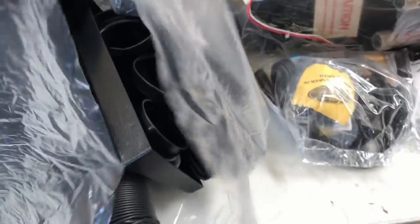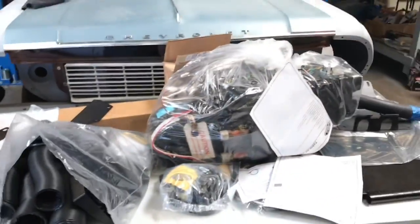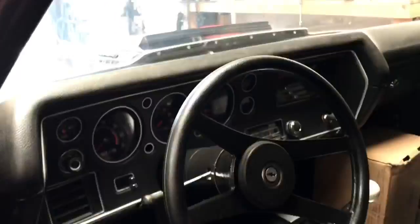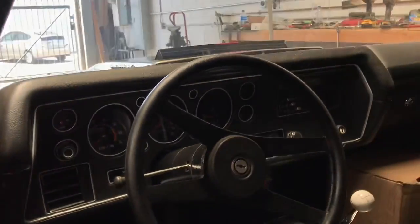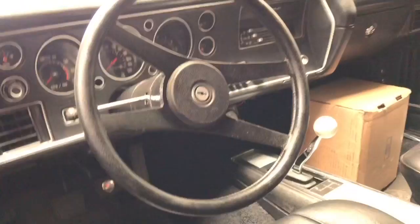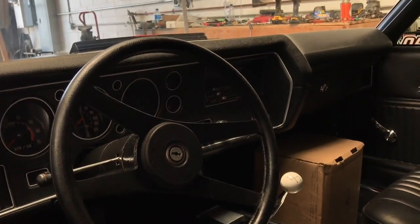The block-offs cover the defrost vents. The amount of work involved in installing this is a lot more than normal. I do a lot of under-dash units because they're pretty simple, but for this behind-dash installation I have to take out the entire dashboard - that means removing the upper dash pad, dropping the steering column, removing the wiring harness, the fuse box, and the entire lower dashboard, which is a big fiasco. I'll take some pictures along the way so you guys can join in the fun.